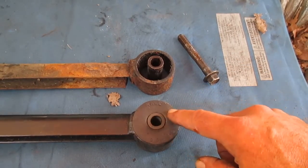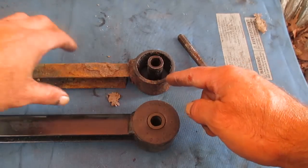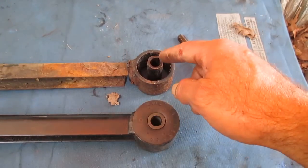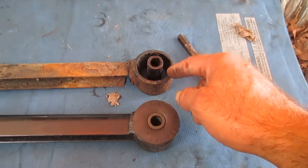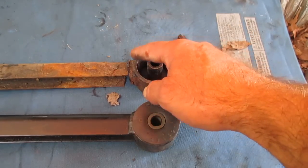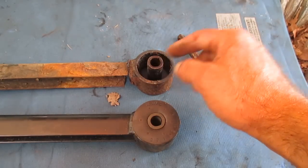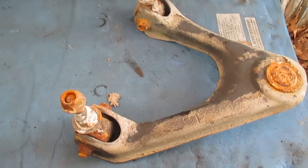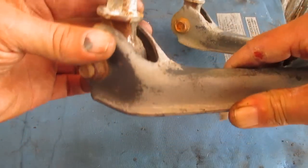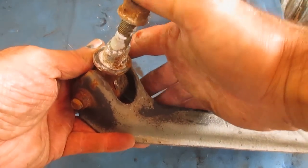Here's the new one I'm going to put on. Again, there's the rubber around it and the steel sleeve. Here's the one that came out — that track bar broke. That's why the bushing was so difficult to get out, because this piece was seized up in the fitting from the bottom of the vehicle. Here's where the rubber would have been until I burnt it out and pried it with a screwdriver. Bushings aren't only on track bars — they're on any part where there's movement required and the part connects to your vehicle.